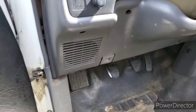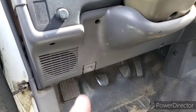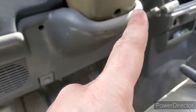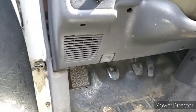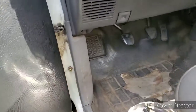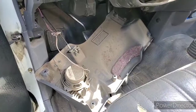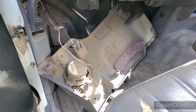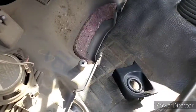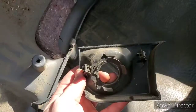On the driver's side now, and as far as I can tell it has the same setup as the passenger side — four screws and one 10 millimeter socket bolt right there. I'm going to try to take it out now. It was just those four screws and that one bolt, a little bit of finagling, and it came down. It also brought this little cover with it, but it just clips on so I'll clip it back on later.